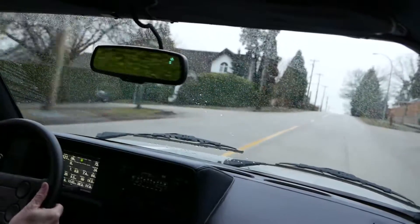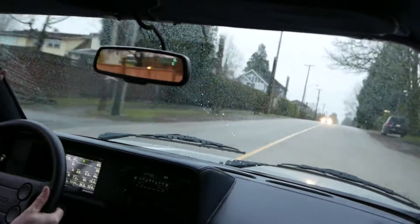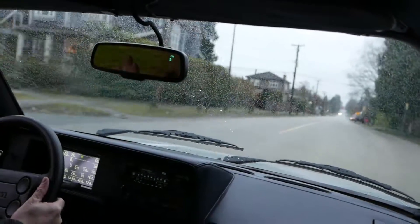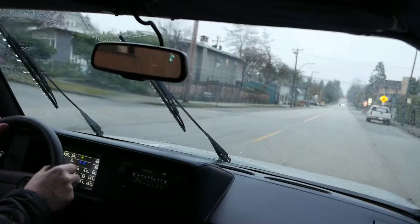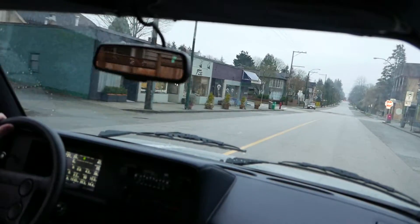Excuse my terrible driving. You gotta be careful when you get into that sort of take-your-foot-off-the-throttle moment. If you haven't pushed the clutch all the way, you'll get that foot shaking — that'll lift the throttle uncontrollably and you get that stuttering. So you kinda live with the fact that ITBs are quite sensitive that way.